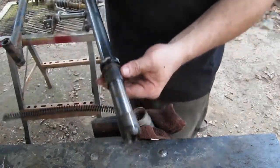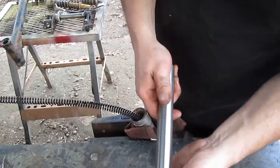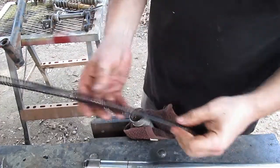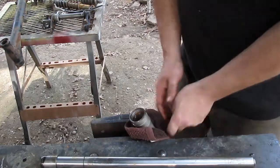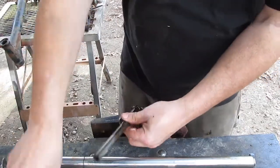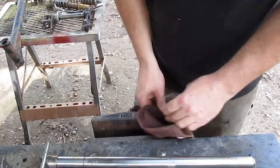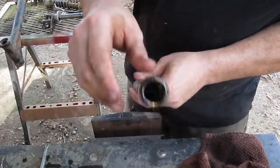There's a spring. I'm going to take the oil seal off, take the spacer off, and we're going to take the damper out — it's just floating in there. We'll take this end piece off, and this is another snap ring.